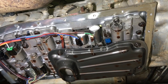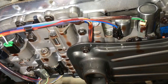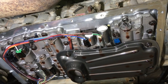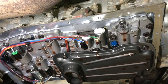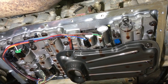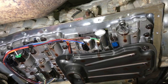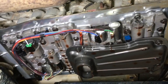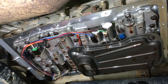There's no need to change the filter - it doesn't stop filtering, it doesn't become blocked. Can you see in the middle there? It's white and clear. You're wasting your time and money if you remove this pan. What matters is clean oil. This one's fairly clean - a decent color. These transmissions without maintenance just seem to be bulletproof and last forever. Transmission oil is the lifeblood - it's the lubrication that protects all your components. Engine oil is much more important to change because of the contaminants.